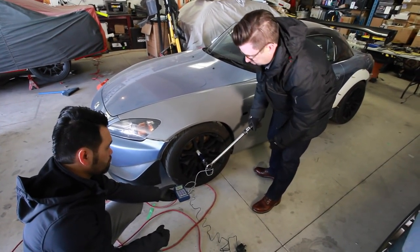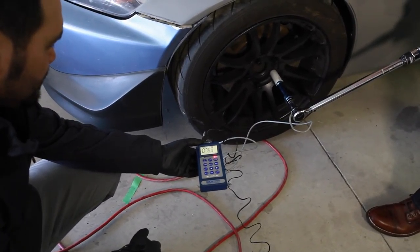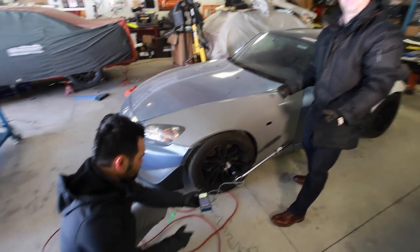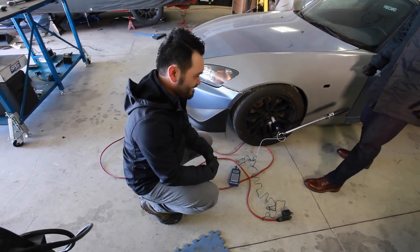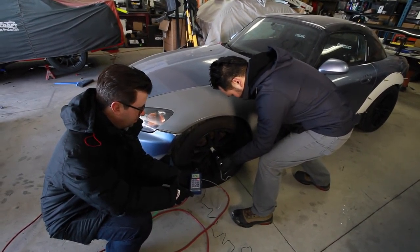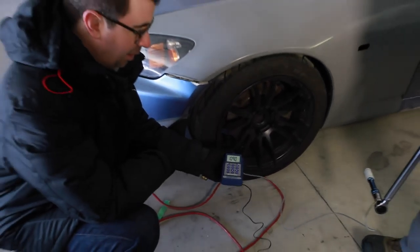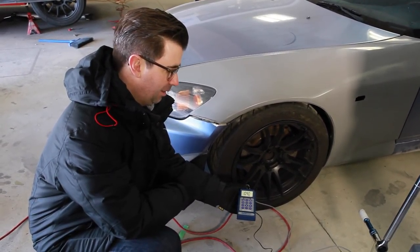With the new wrench zeroed — it's reading 82 to 82.3, so it's accurate and consistent, just slightly high. Now for the shootout: Ken is playing Pete with the fast, aggressive technique. The first hit was 98 and the last one was 109 foot-pounds — with the wrench set to 80. He overshot by almost 30 foot-pounds using the Pete technique.